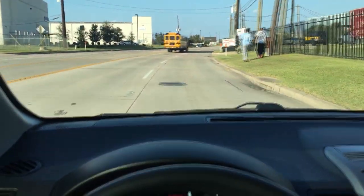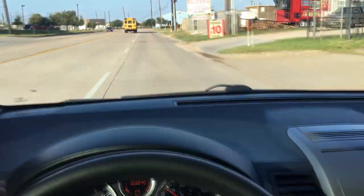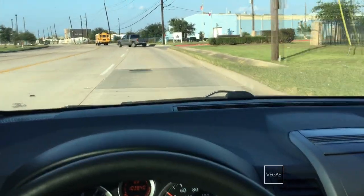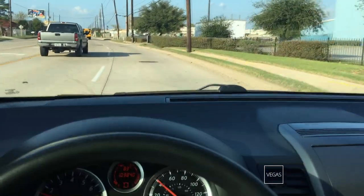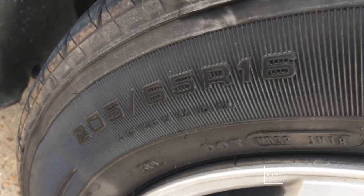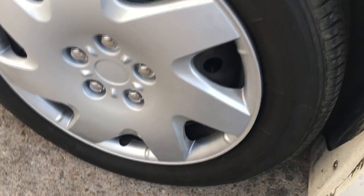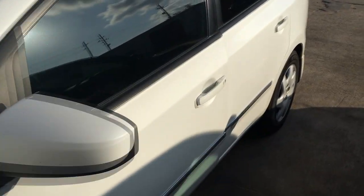I'm going to check the tire sizes to see if they're different. After driving around for a while, one of the things I could not duplicate is the speedometer going out on me — it seems to stay working and I don't see the check engine light, ABS light, or traction control light staying on. But I'm curious about this difference in wheel speed. Check this out: on the rear tires we have 205/65 R16s, and up in the front we have 205/55 R16s. So we have 55s in the front and 65s in the back. What we're going to do next is rotate the tires to see if the speeds change from front to rear.